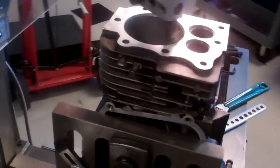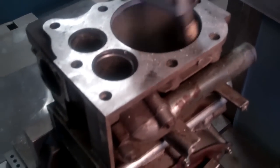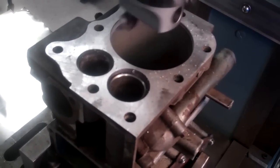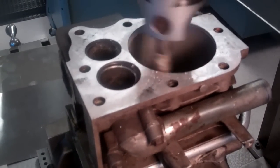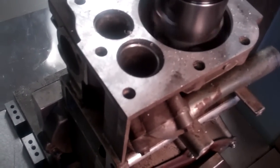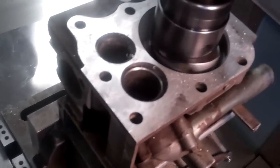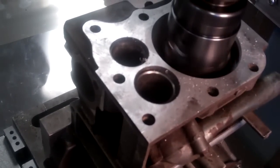I'm taking a nice light cut and I want to get down until I'm sure it's cutting evenly all the way down the cylinder, because the cylinder is not round anymore. I'm taking my best guess as to where I need to be to get the best cut. It seems to actually be cutting fairly evenly now. The cylinder is not exactly round but it's for the most part cleaning up with a very light cut, so I feel pretty confident I'll be able to successfully bore this to 20 thousandths over.